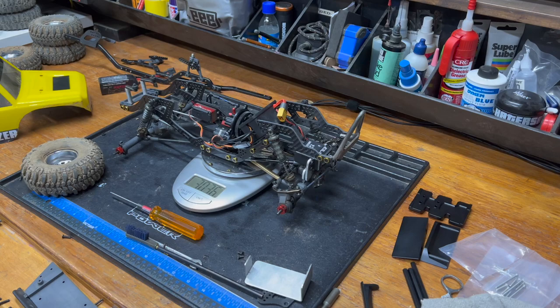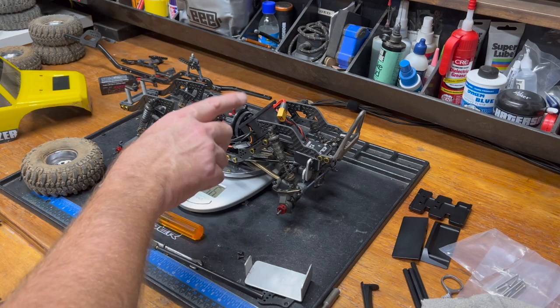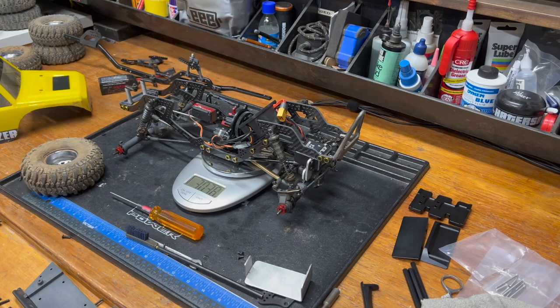And it's not critical. These are rock crawlers. I'm not attempting to build an ultralight or a super light. What I want is the forward kick, and I want more shock mounting positions. I tried to clone the existing shock mounting position so I don't have to mess with spring rates again, because I feel like this guy was tuned in pretty well.